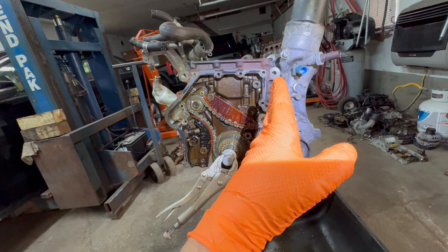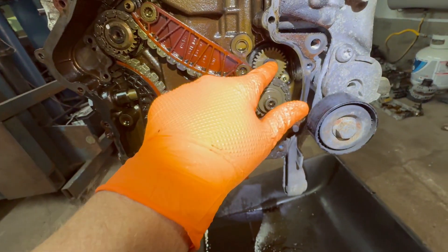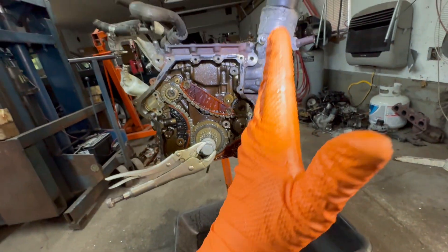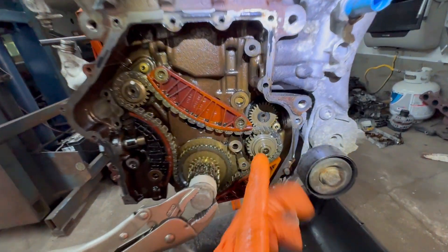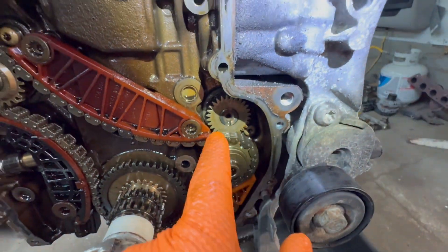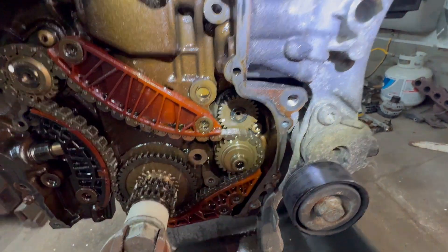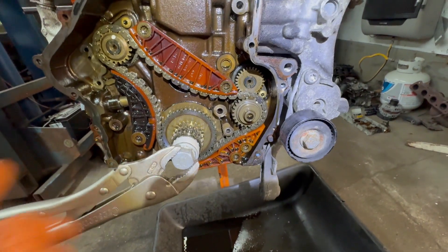If you look at the engine, it looks like it's a little bit on an angle like that. So that dot — there's a slot here — you want it basically just pretty much in line with the engine. You want it straight. If the engine is on a little angle like this, you want that notch — see this little notch here? One and two. Directly below that is your timing mark. That one has to be up and down like that — a little bit more like that.